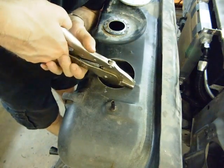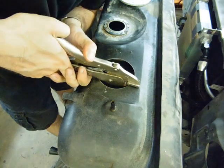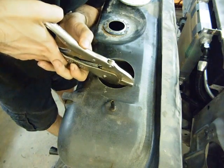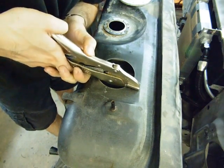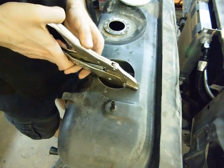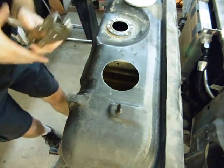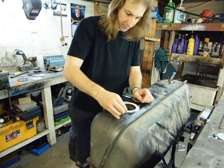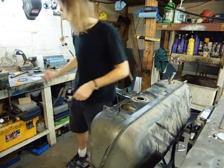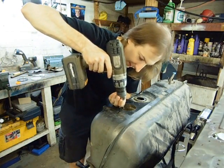While that retaining ring is cooling down, there's just a little hump right here in the tank for some unknown reason. I'll flatten that down so it doesn't interfere with the seating of my flanges. I'm not using the hammer and dolly here because I don't want to create a spark — this is a used fuel tank. Now that the holes are marked using another paper template, I have to drill the same set of holes on the tank.